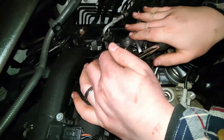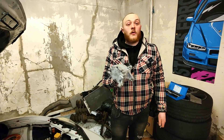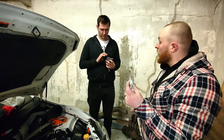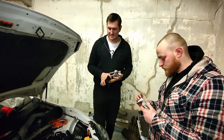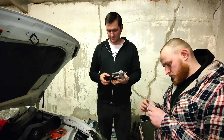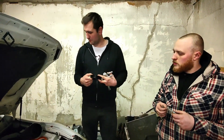Let's see if I can't smash my knuckles while doing this. And that is one heavy aircon compressor. Lots of nice new individually packaged genuine Subaru bolts. What I will do, as our new ritual, is copper grease all of these before they go in. I don't particularly see any reason to take them off in the future, but it's just helpful. They're steel bolts going into an aluminium casting, so when they haven't been off for a really long time they just get really tight and seize up. If you put copper grease on it means you don't have that problem later on. So that's the bracket going in, and that is the new pulley - it's much lighter than the aircon pump that came out.